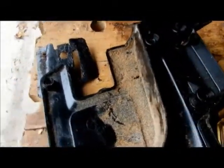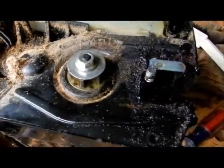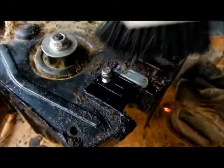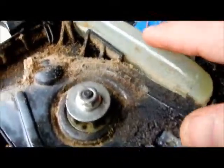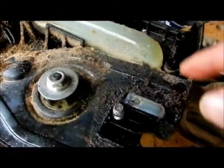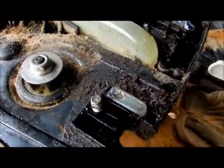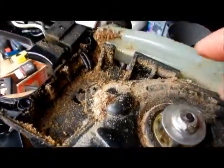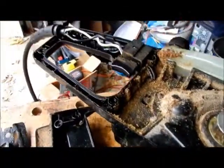Take a brush and brush off the pieces as much as possible before putting any alcohol or detergent on there, to get them really sparkling clean — just really get the gunk off, get all the heavy dirt out. This is where the chain oil goes — it goes through and comes out here and dispenses through that little hole right there, so you want to keep that clear. The motor looks in really good condition — the motor works, the chainsaw works as you saw in a previous video.